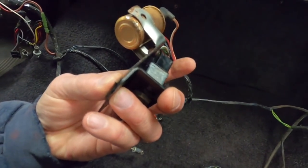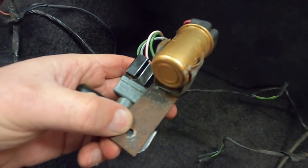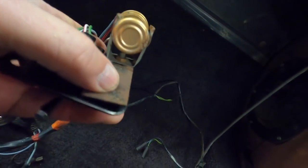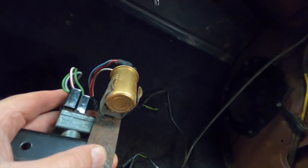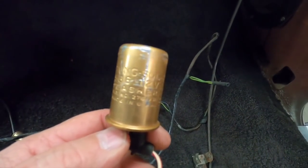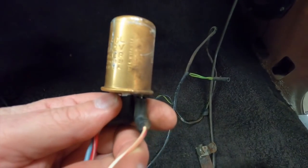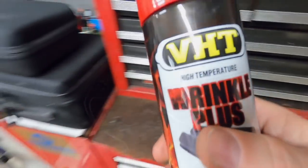I looked at some old photos and this bracket doesn't attach to the top of the dash - it attaches right here. This is in the glove box, screwed into the dash, and when you open the glove box door you see this. That holds the flasher unit in place for the four-ways. In case you're wondering, it says Tung-Sol 536, 12-volt flasher - that's the flasher unit number.